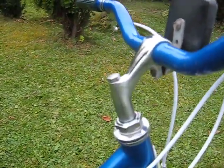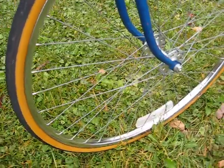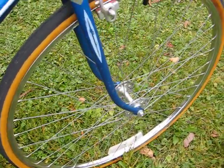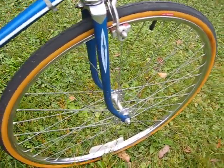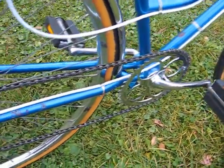It's got a beautiful stem and beautiful headset. In fact, it just has nice chrome all around. It has a nice set of chrome wheels that are respectably straight — they just had a little bit of wheelsmithing work done to them. I put a half turn on each spoke and then performed the final true on my TS-2.